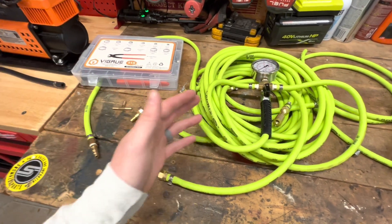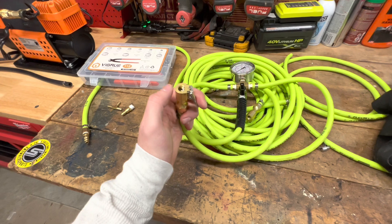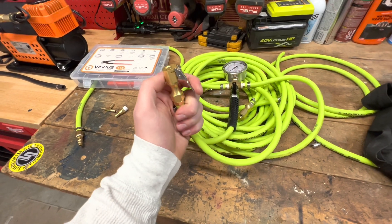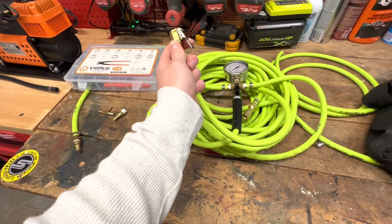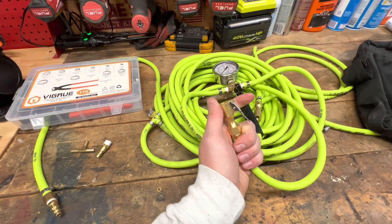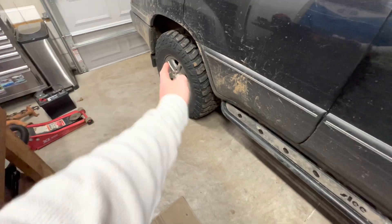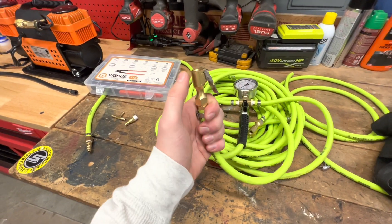In terms of components, the first and arguably most important is the air chuck for your tire. You need four of these — one per tire — and they clip on very nicely and hold in place. What's important when purchasing these is to make sure they are closed-style chucks. If they were open, removing it from the first tire would let air escape from all the remaining connected tires. Make sure you get the closed form — I'll link these in the description below.